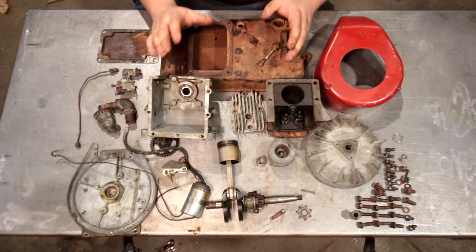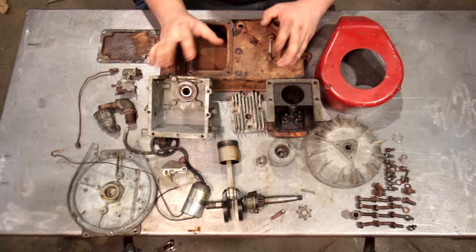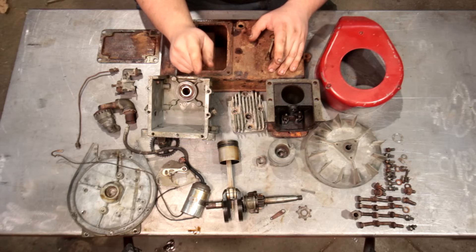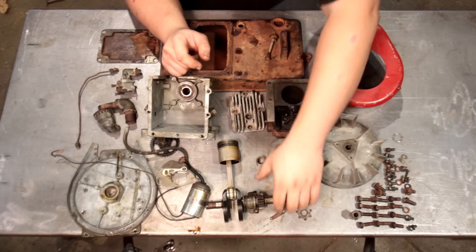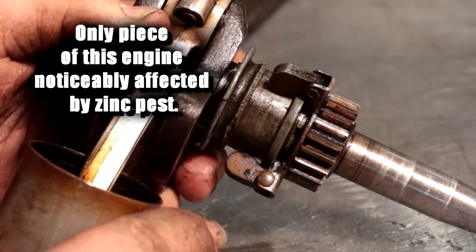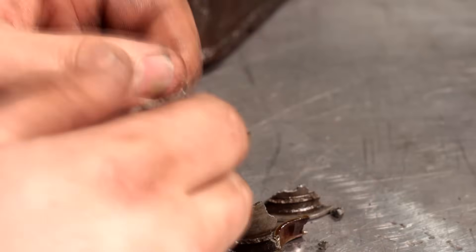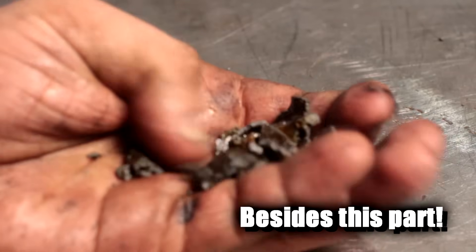This engine is still delicate — even if the material is in good shape — for how small and thin they made it. And then you add the fact that the material, if it is the wrong batch of it, could destroy itself just with age. None of the major components have any zinc pest or swelling happening to them. But there is one part on this engine made out of the same material as almost everything else that actually did get some in it — that being the governor collar on the crankshaft right here. This has zinc pest in it; it's all broken up and chipped away. Somebody already removed the governor off this thing a long time ago externally. This piece has cracks in it, just like any typical swelled-up pot metal does, and it's the only piece in this engine that did it. Which means when they were making this back in the day, they had some really clean material with no impurities in it, and they did a good job for the most part.